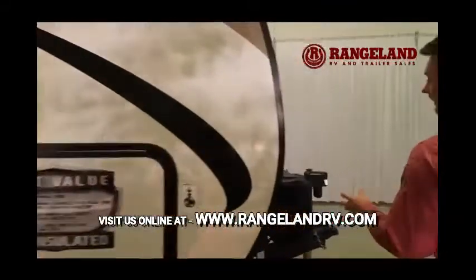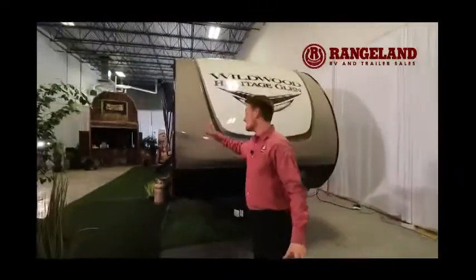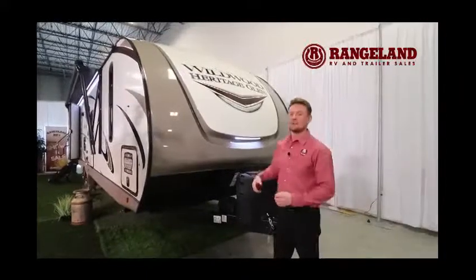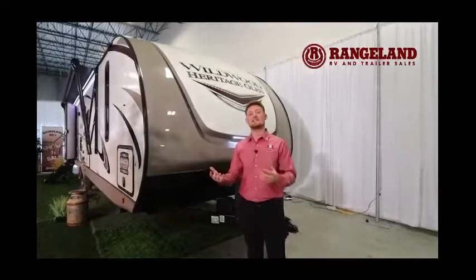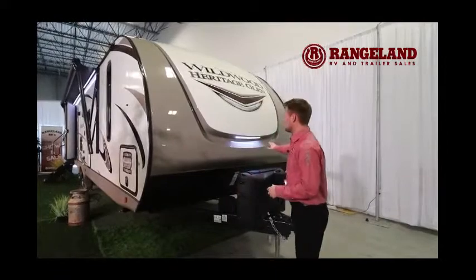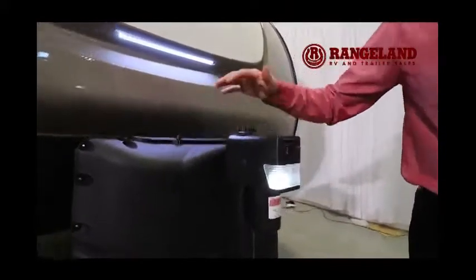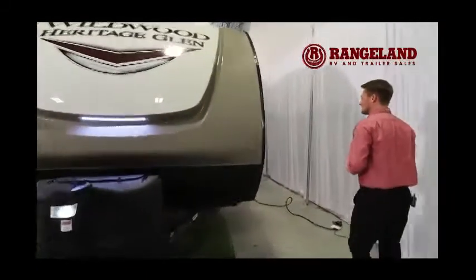So as we go up to the front side of the trailer here, one of the big construction features on this Heritage Glen is this big fiberglass painted cap. One of the big benefits that you do get out of this is it covers the main roof seal on the top of the trailer. So that's eliminating the chances of having water seeping into the front cap of the trailer and it causing delamination, which are those bubbles that you sometimes see. Now, it's also really nicely appointed with this LED light strip here, so it cleans that look up again. You have two 20 pound propane tanks on the front of the trailer also, and you'll even have a power tongue jack here. Follow me around this way and we'll continue talking about some of these cool exterior features.